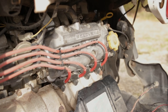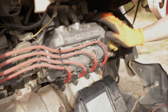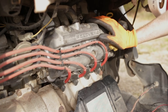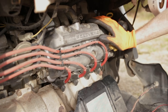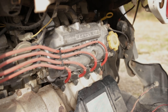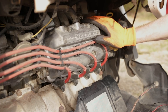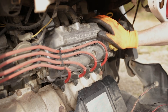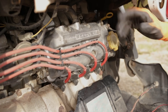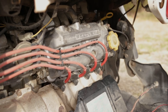Snug that down and we are done with the procedure of adjusting valves and replacing a leaking rocker cover gasket on a Subaru Clover 4, 660 cc engine in a Sambar wagon or truck. This will basically cover the Subaru Vivio and some front wheel drive Subaru K cars that use this engine and drivetrain as well. I do not have an oil filter in stock handy to do the oil and filter change, and I would like to let that RTV cure for the full 24 hours before having oil circulating in the engine and inside the rocker cover, to avoid washing that RTV into the oil pan and high pressure system. Thank you guys so much for watching, hope you enjoyed, and I will see you in the next video.